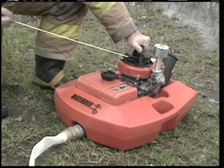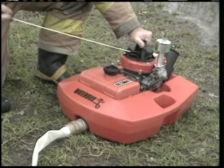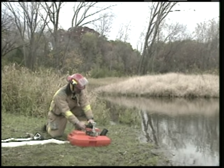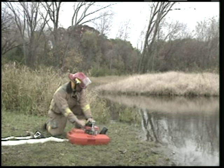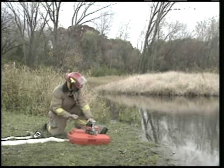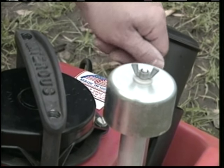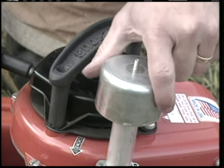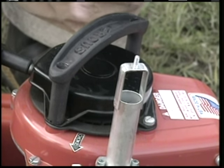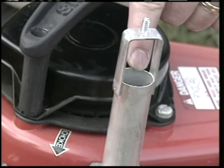Be sure to pull the handle slowly to release some of the pressure; otherwise, the handle may snap back out of your hands. The high-compression 8-horsepower engine may also kick back when you try to start it, so be careful. If the engine doesn't start, have the spark plug checked or replaced. If the spark plug is okay, remove the air intake and pour in one tablespoon of the gas and oil mixture, then close the intake and pull the starter again.